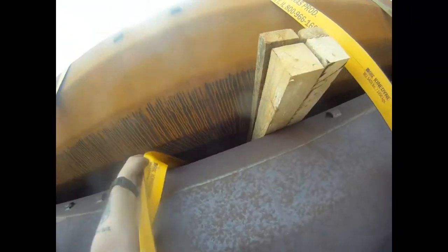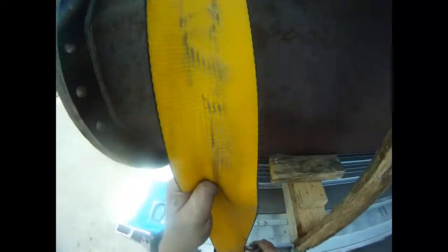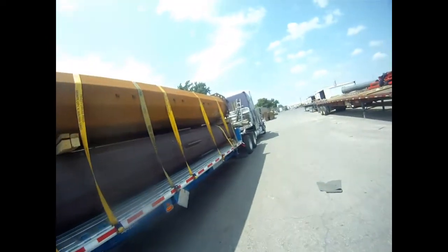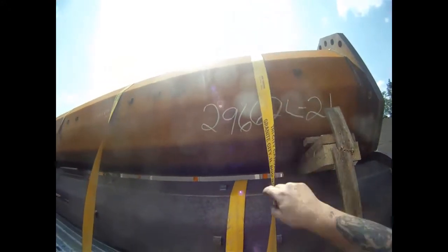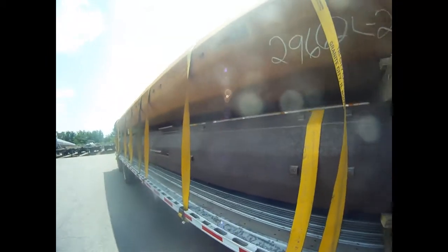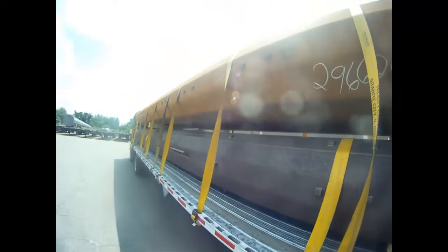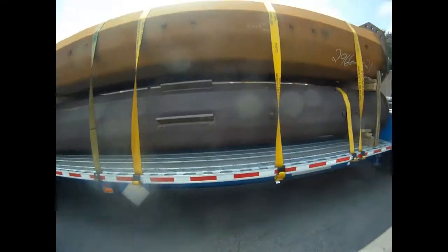These are fairly short here, this shouldn't be an issue. I would love to get my twist in. Let's go ahead and do it and be done with it. These ones that are up high, they're gone big time. I've got only three bellies but they're spaced out. Load is 33,000 pounds. Working load limit is 5,400, so I want to make sure I've got enough to cover pretty much the bottom half if I need to. Half of 33,000 is 16,500 — having three straps is great. I just want to make sure I've got coverage down on the bottom.